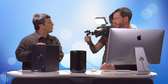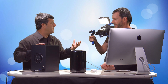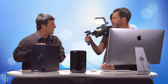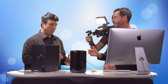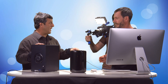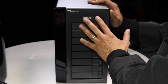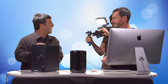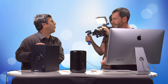This is configured as RAID 5, which gives you security and redundancy. If any one drive fails, you put in another drive, it reconfigures itself, and you don't lose data. You get speed but also protection. You have options to configure it different ways. This particular unit has three terabyte drives, so it's a 24 terabyte array — but because one drive is used for redundancy, you only get 21 terabytes.